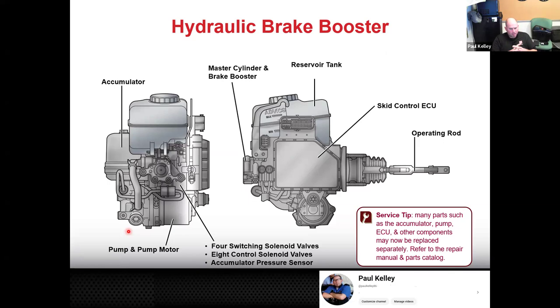And then we have several solenoids and those are switching. They can allow you to apply the brakes, not apply the brakes, build brake pressure, release brake pressure, et cetera. Maybe even up to 8 control solenoids, an accumulator pressure sensor. So this knows what your pressure is. If your accumulator pressure is getting low, lower than it should be, what do you think it's going to do? Oh, I know. It'll run the pump and motor, and the pump and motor will build the brake pressure back up